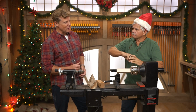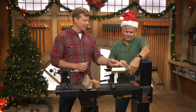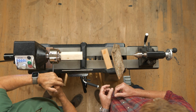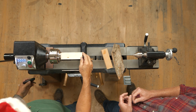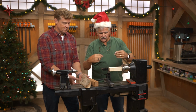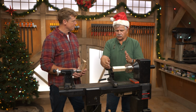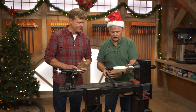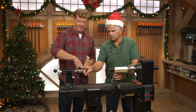I know you've taught me how to lathe once or twice, but you're gonna have to refresh my memory, Tommy. Chuck? This is a chuck. And this is a 4-jaw chuck, and this end is square. Normally we'd find the centers to put one on this side and then center it on this side, and it spins in between. Because this piece is so short, I can just do it right off of here, and it's faster. And what's this called again? That is called a center. This is a live center right there.